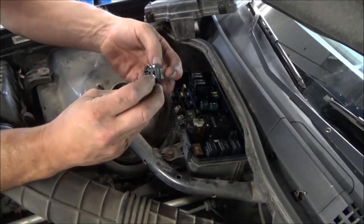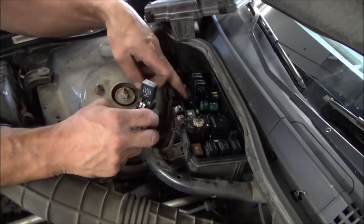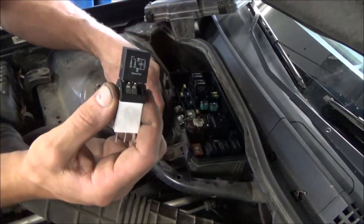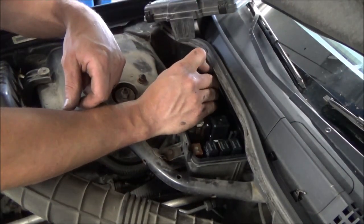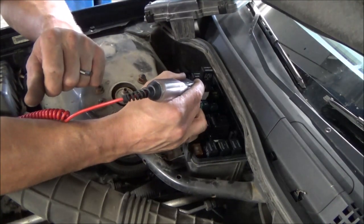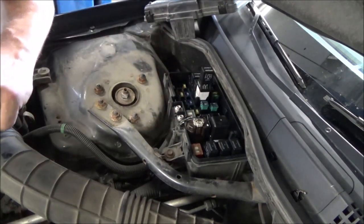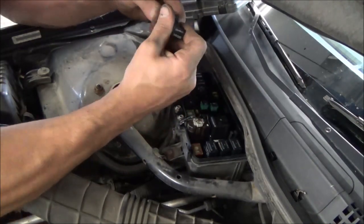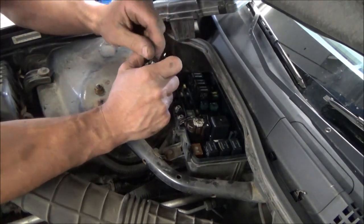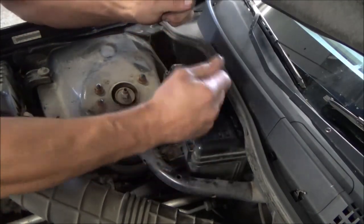So I've got my little relay jumper here. It basically allows us to bypass the relay, or get the relay up out of the box — because this one has those little covers on it, making it hard to jump across and trigger the relay manually. I've got my test light hooked to ground, and we'll just go across these pins — one of them will trigger the relay. Obviously that's the pin. So that tells us a lot: our horn's good, the wiring to the horn is good, the fuse is good, everything is good coming to the relay. Except we may not have the trigger from the horn button itself, so we still have to go in and test that.